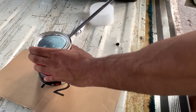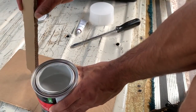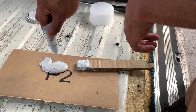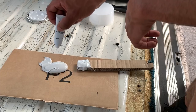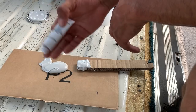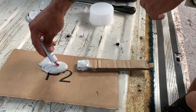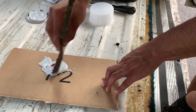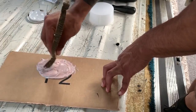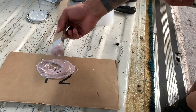Just go around it with a screwdriver or a knife. So what you're gonna do is put some of this body filler onto your cardboard, then bring out your hardener and squirt a little bit onto your body filler — it's gonna start the hardening process. Mix it in and then apply it to your hole. In a few minutes that's gonna be completely hard, just like the metal of the floor. You want to mix it real good until it's pink like this, and then you've got to move quickly because if you don't, it's gonna harden right there on the cardboard.